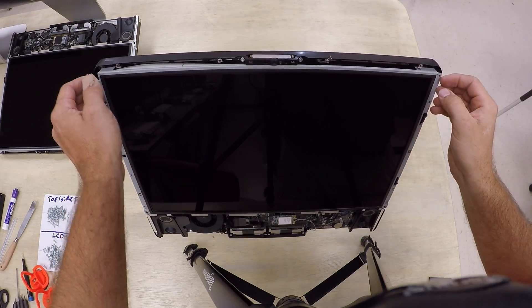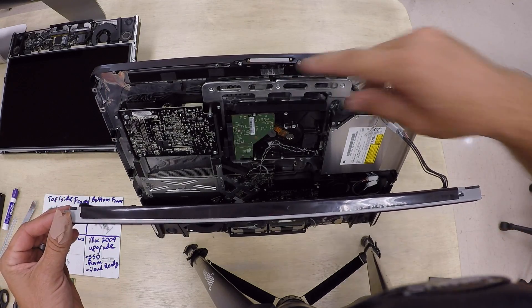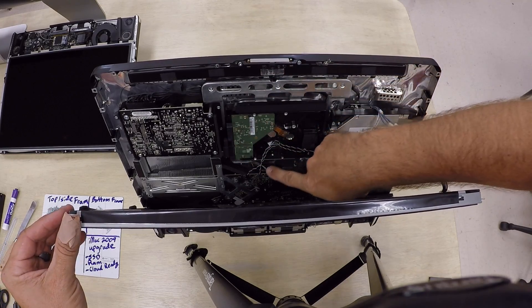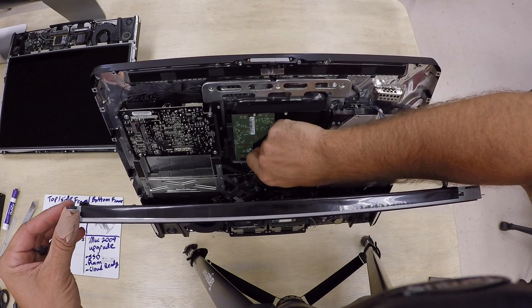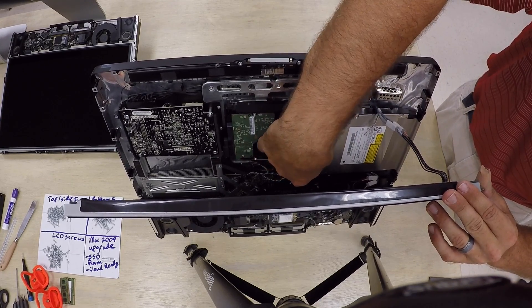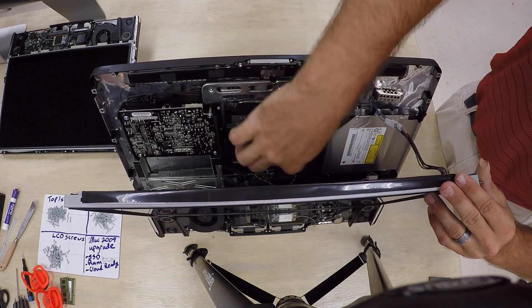Get above the computer and have a partner hold the screen. Loosen up the cables without pulling them out — there are two cables for the screen at the top and two at the bottom. The exposed area is your power supply — never have your computer plugged in, it will electrocute you. There is also the hard drive, CD drive, and sensor cables. Be extra careful not to pull the sensor cables out, because if you do, the computer will turn the fans on to full blast. Work out the sensor stuck to the back of the hard drive — it's held on by sticky tape — and place it safely to the side.